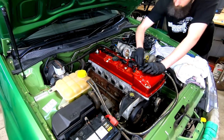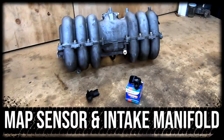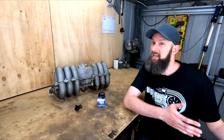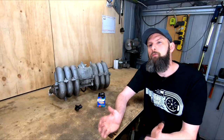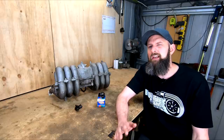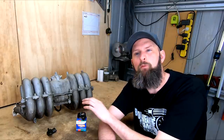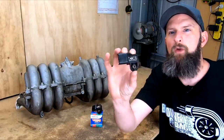I'll leave that coil cover off for the next job. The factory MAP, or manifold air pressure sensor, detects the air pressure in our intake. On these NA cars it's listed at 1 bar or around 14.5 psi, and has a range that can actually read up to more like 1.18 bar. That sounds like plenty, except until you consider that we exist in Earth's atmosphere, which has that air already at around 14.7 psi of pressure. If we compress that air further as we do with boost, we'll very quickly be past that limit. So we need to install a sensor that won't be maxed out and allow the ECU to see boost — we can do this with a factory turbo map sensor, referred to as a 2-bar map sensor, with a range closer to 2.5 bar or around 21-22 psi of boost pressure.